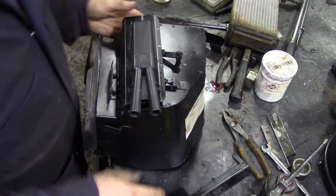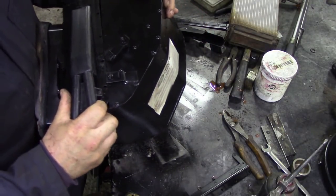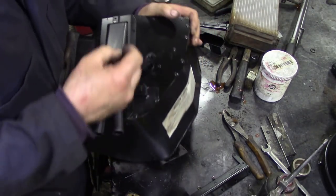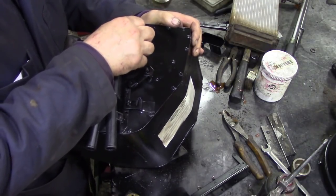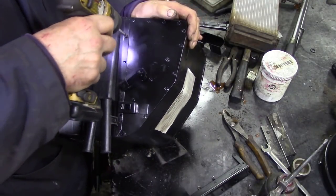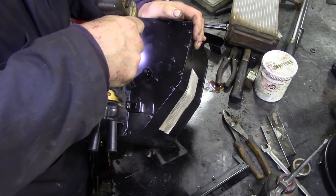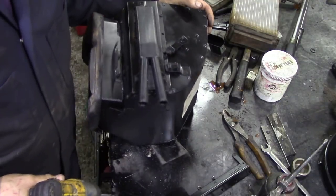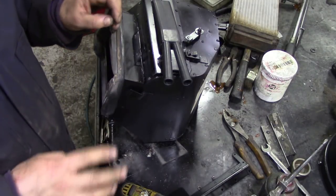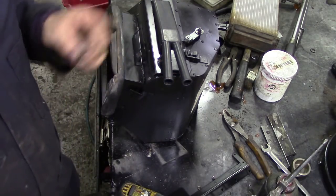Oh, that's it. Right. Now, we've got to get under this lever here. So lift the heater up, push it forwards, grab a screw, and push it in. Now, the key to anything when you're doing nuts and bolts, washers, studs, anything: put the bolts through the holes first and then go around them and tighten them up. Don't just put one in and tighten it up because it'll hinder you. I'm going to put the screws in here, then we'll have a look at the bottom.